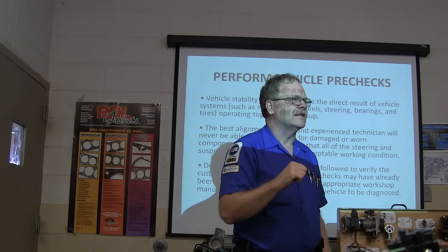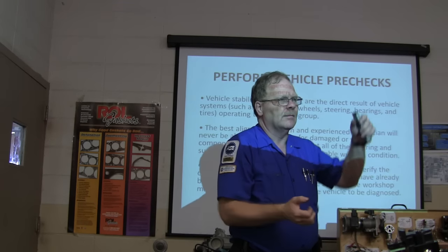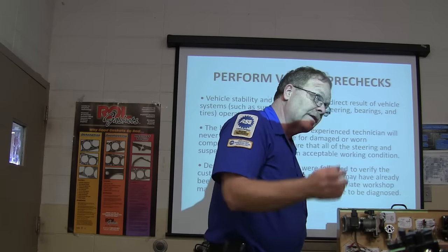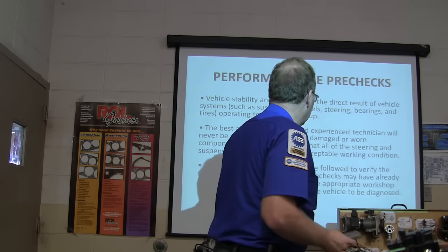While they're moving the wheel, you'll see worn-out parts if there are any. For ball joints, you've got to actually take the weight off them and grab the tire to see them. The dry park check is basically letting the car sit on the ground, getting under there, and looking to see where all the slack is — so you know what parts need to be replaced. That's the preparation.